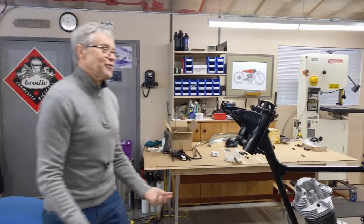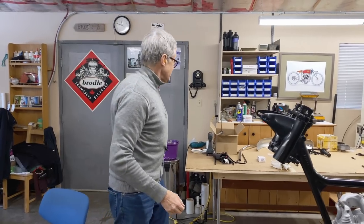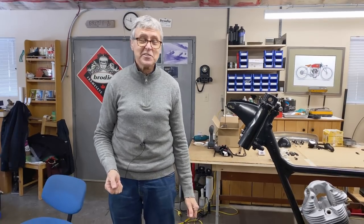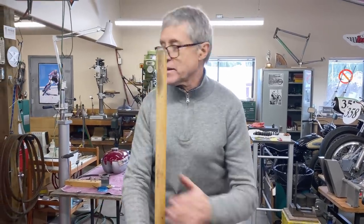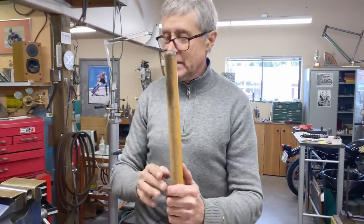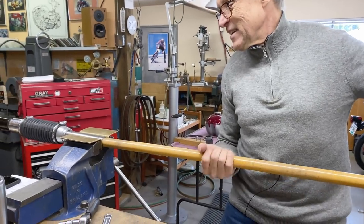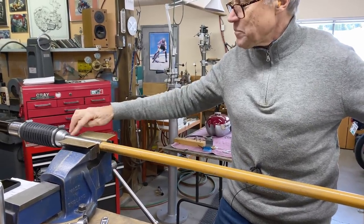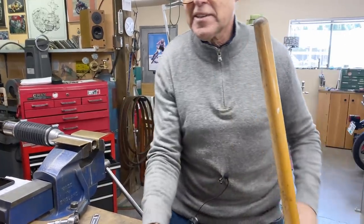Now we have to put the forks up there. What's interesting about this is that in the Haynes manual, it doesn't mention any special tool. Well, it does mention a special tool. It mentions a broom handle. I guess you're supposed to cut your broom handle off or whatever. And the broom handle threads into here, so that you have something which pulls up the fork tube, because there's no way, if you look at this,